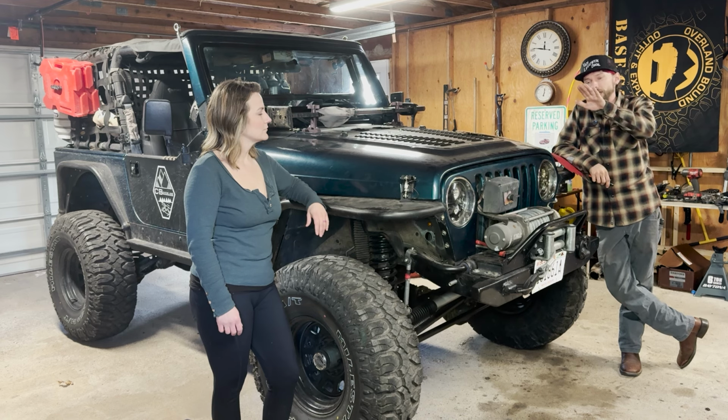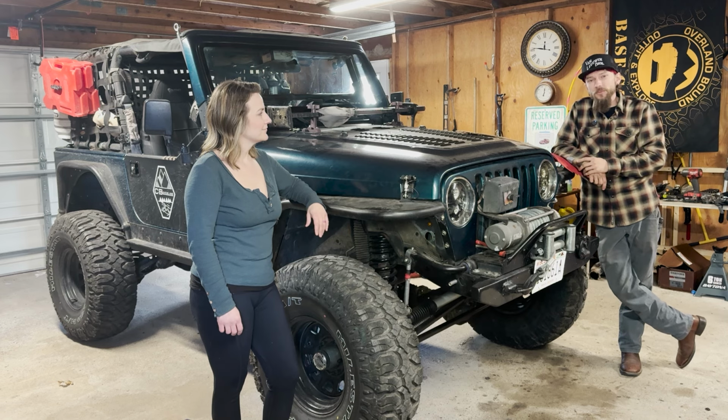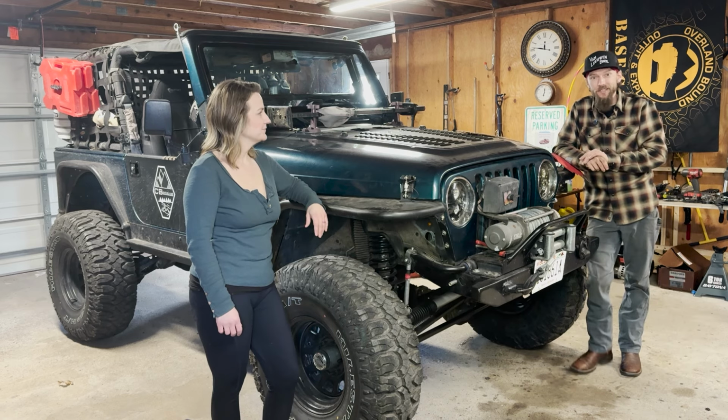So once you're leaning back, it's not just that you're leaning; you're causing a bunch of other problems. You've got oiling issues in the engine. We're sitting at the wrong angles, and driveline stress, and lots of problems that come with that. So we'll see how that ends up. Absolutely. Before going full custom and just figuring this out.